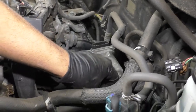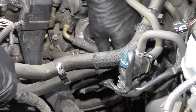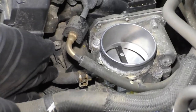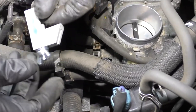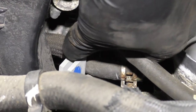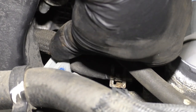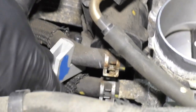There's a fuel line right here — just move that fuel line out of the way. You could take this bracket off if you needed to, but we'll just move it out of the way for now. There are two coolant lines that go to the throttle body. Now what you could do is just pop those lines off, but you're going to lose a lot of coolant. So I'm going to use these coolant hose pinchers — we actually sell these at 1aauto.com. Just put one around here like this and then tighten down the wing nut. That's going to tighten off the coolant and prevent some of the coolant loss. You don't have to tighten these too tight, just snug.